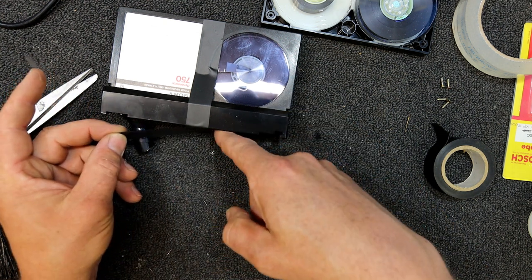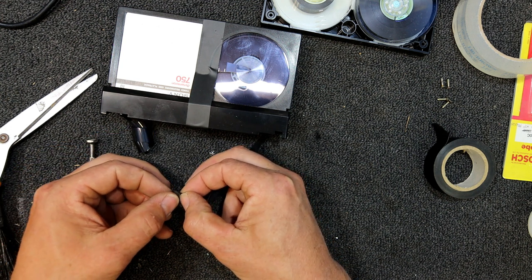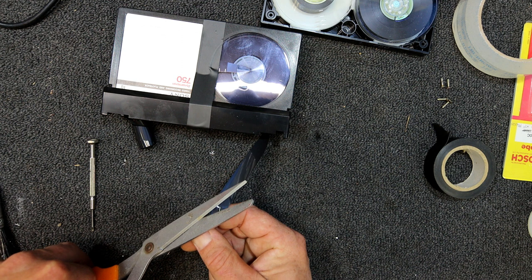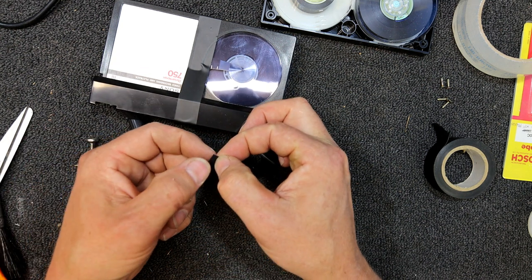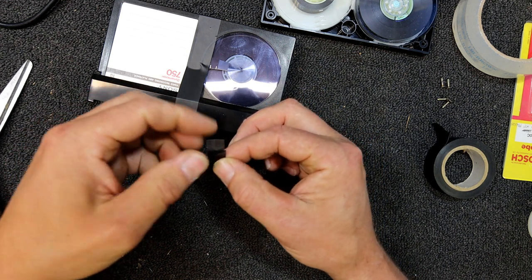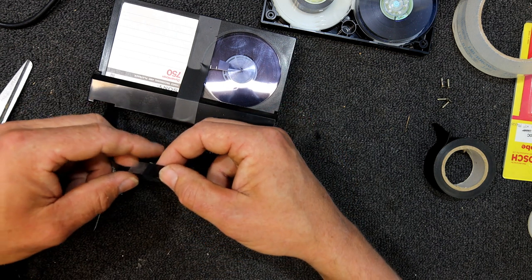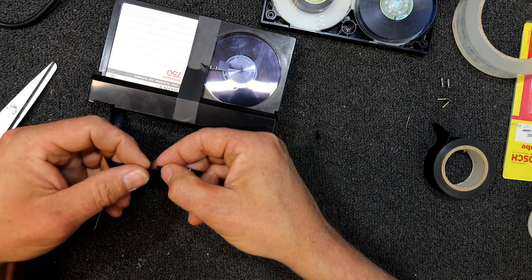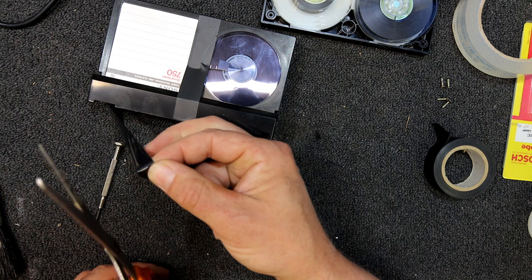You want to get this nice and square on here, and slightly less width than the tape itself — I didn't do the best job there; it's slightly wider. So we don't want any of that stuff sticking out over the edge — you can just trim it off. We don't really want any gap between the two faces, or two pieces of tape on the face. We don't want a sticky surface for anything to stick to in the tape path of the machine, or for the heads to hit.